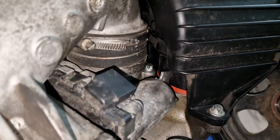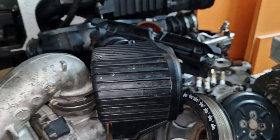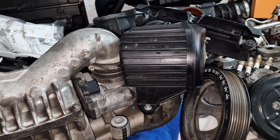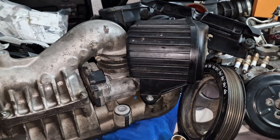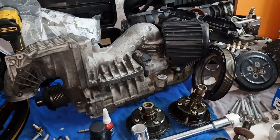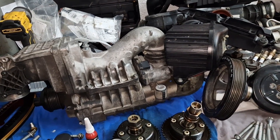Off camera, I changed the orange gasket that goes from the silencer to the compressor body. The old one was a bit worn and needed changing — you can lose boost with a worn gasket, which is bad for the engine, especially under wide open throttle.